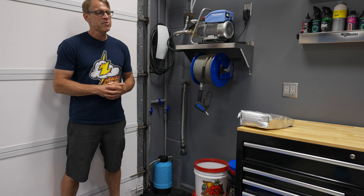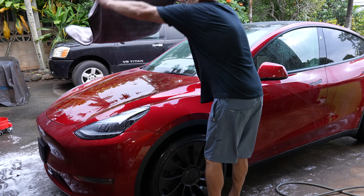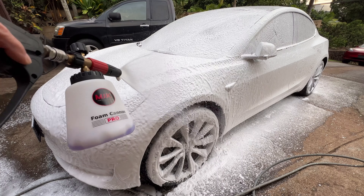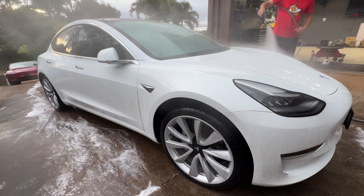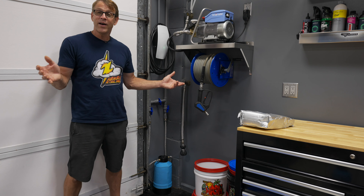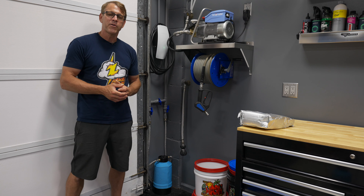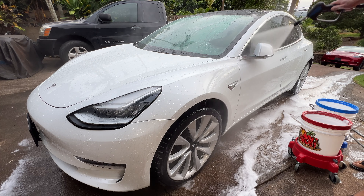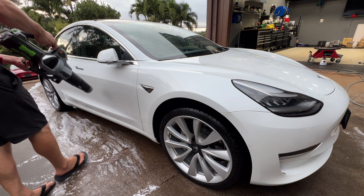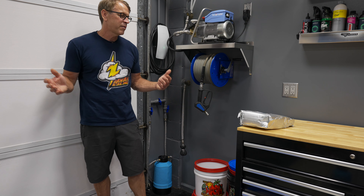Now when would you want to use this kit? The best uses: first, you're washing your car on a hot day and before you can get all the way around and dry it, it's already starting to dry on the paint, leading to spotting. Second, you do the whole wash process, rinse the whole car off, and just decide you're not going to dry it at all — you're fine, no spotting. The third way is how the real serious detailers do it: wash the car, do a final rinse with deionized water, then come back with a leaf blower, blow as much off as you can, and just leave those little dribbly drops because they're not going to leave spots.